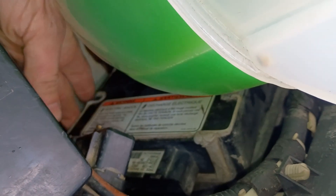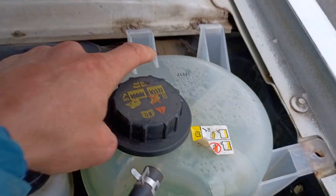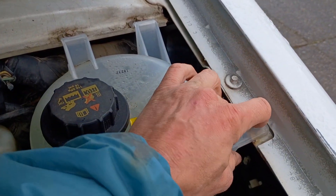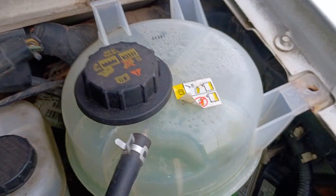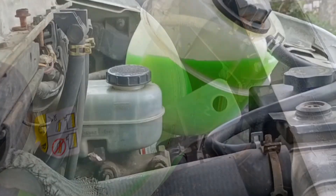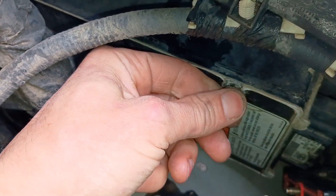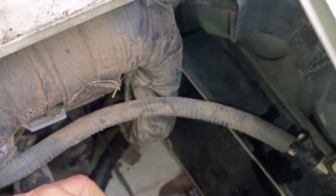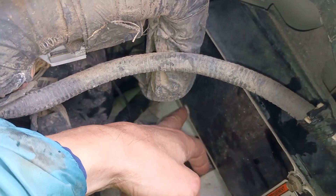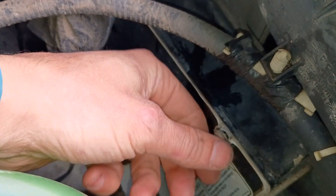I've already got this disconnected. Here is the IDM, and mine is really loose. I think there's supposed to be a second bolt holding it down below, but to get it out I'm gonna first remove these — this one's already missing on my van. I'm gonna pull the degas canister off and just scoot it to the side so I've got some room to work. Now that I've got that degas container out of the way, you can really clearly see the IDM. Mine is held on with just one bolt, and I'm actually able to loosen that by hand. It looks like there should be three or four — you can see there's another one back in there, and it looks like they've all just fallen out.